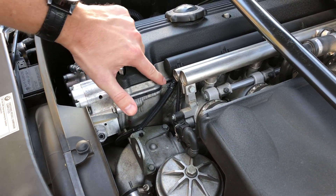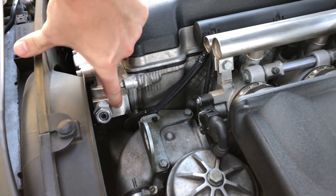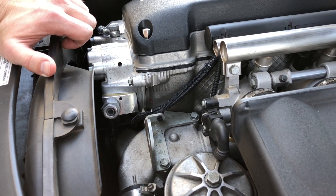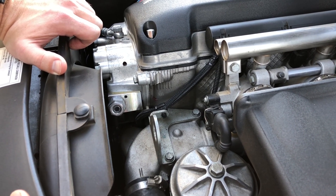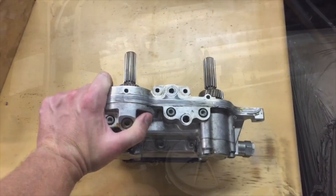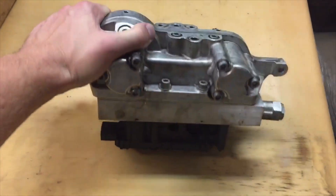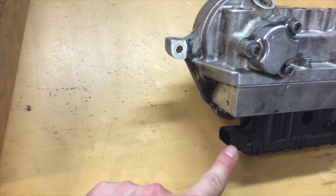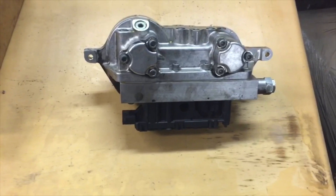For your reference, the plug we're replacing comes down through here, wraps around, and plugs into the bottom of the solenoid pack. It's a six-prong plug. Most likely you'll just need to replace the case — normally the plug itself is okay but the case gets damaged. Three dollar investment. Here's our vanos as it was installed into the car, here's our solenoid pack, and here's where that connector plugs in.